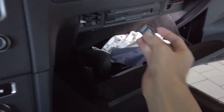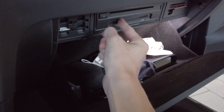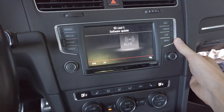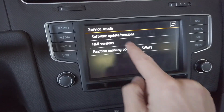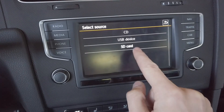I'm going to place the SD card in the SD1 port. Then we're going to press and hold the menu button for about five seconds to enter service mode, and from there navigate to Software Update > Update SD Card.